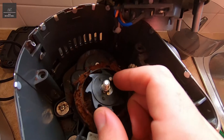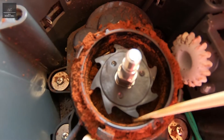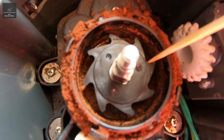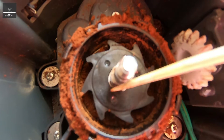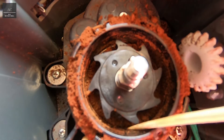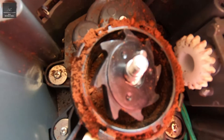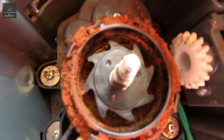But the actual realisation is — let's put it back in. Even though it looks okay, if I run the sharp edge of this skewer all the way around, I can actually go and clear all the impeller fins. So have a look here and here. When this impeller is new, the actual fins should just be clearing the cylinder wall. In our case they're not — so what's happening is coffee is going through because there is so much gap between the impeller and the cylinder wall. It's actually making it a lot easier for coffee beans to jam the mechanism, and that's most likely what's happened. I don't know yet whether I've also burnt out the motor trying to grind coffee, or if it's just a matter of replacing this impeller.